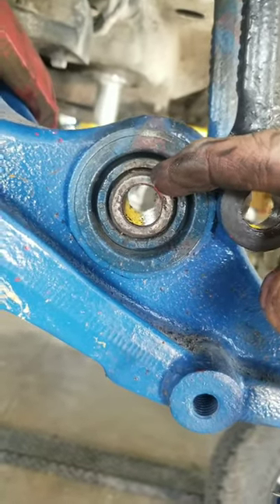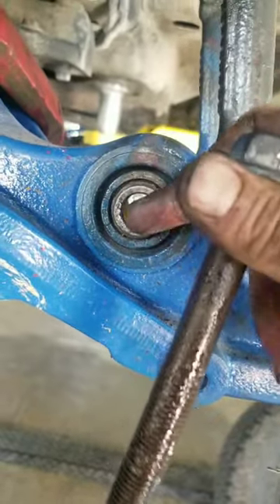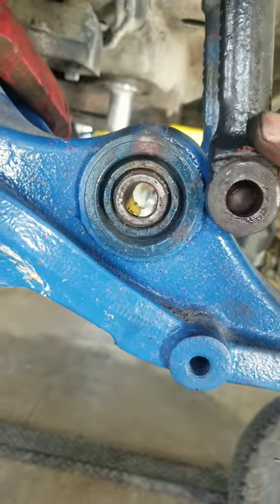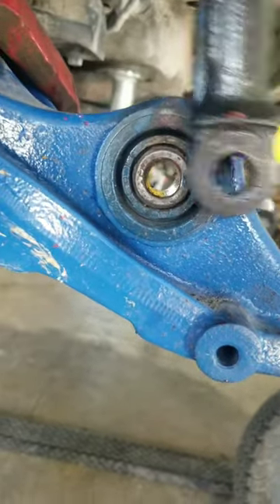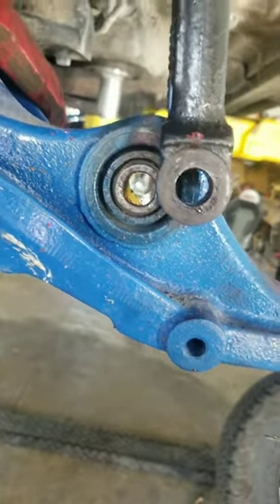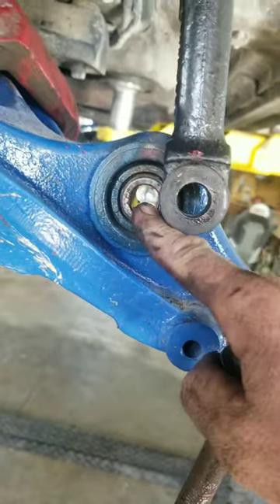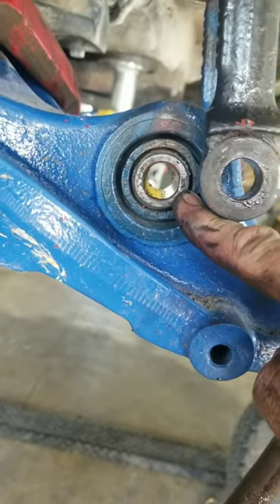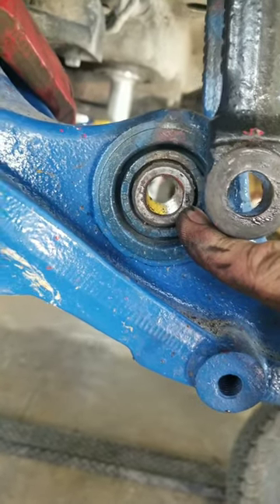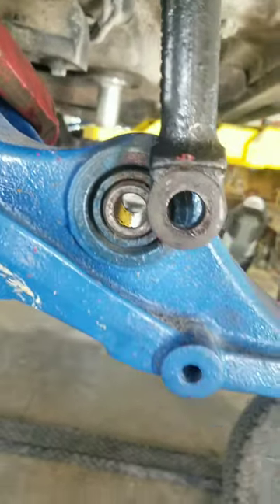That's the issue with an impact — we had a huge impact on it and it still wouldn't do it. We've tried hammers, we've tried everything else. Your best bet is going to be to cut this bolt on the inside, both sides of the strut fork, then pop the heads off and pull it off, and then replace your bushing or the whole lower control arm. The bolt seizes to that metal sleeve, which is inside rubber, so an impact does very little because the rubber just gives — there's nothing to hold the outside tight.